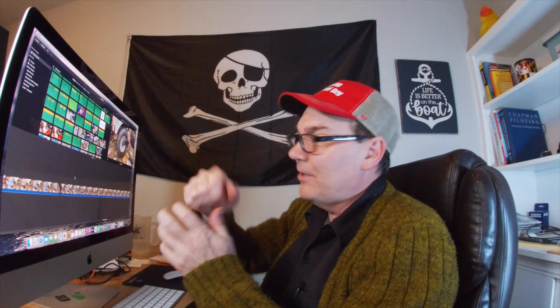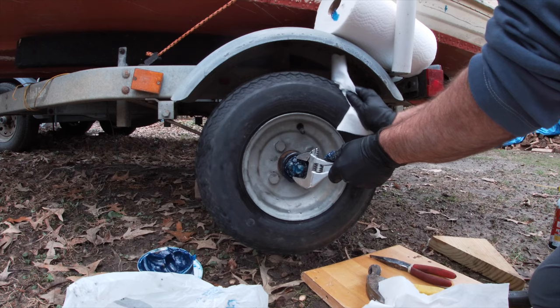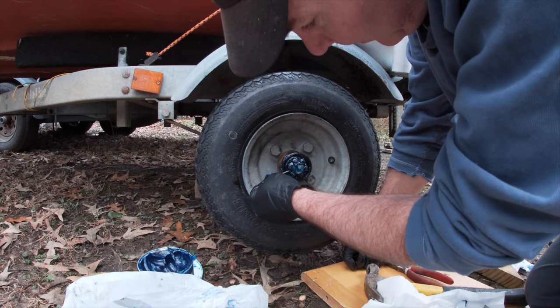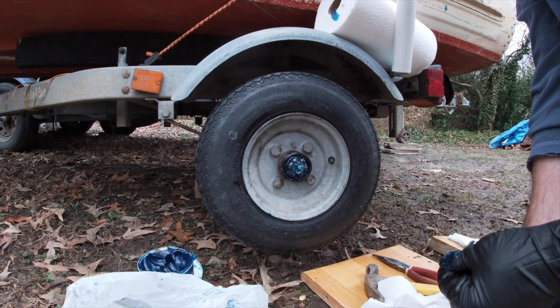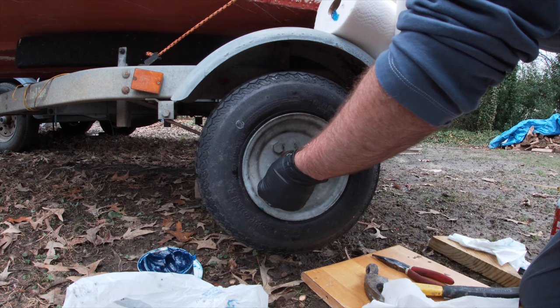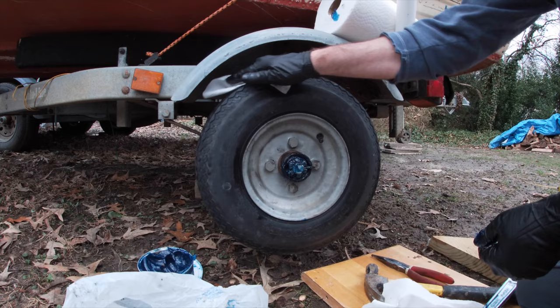The castle nut goes all the way tightened and then just a little bit loosened so the cotter pin can go through the axle shaft. I put my adjustable wrench on there to snug it down all the way, then check that the wheel is spinning correctly. Everything feels all right — it's not too tight, not too loose, not wobbling. Then we grab our brand new cotter pin and line it up with the hole. The holes are filled with grease so I have to go by feel. I move the castle nut back and forth a little to get the cotter pin lined up, then double check the wheel once the pin is through, and bend the tabs to lock it in place.